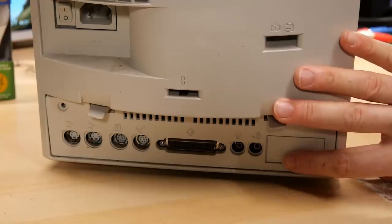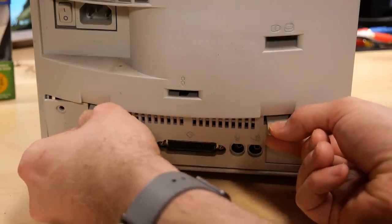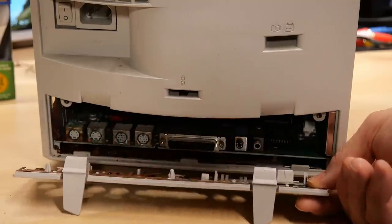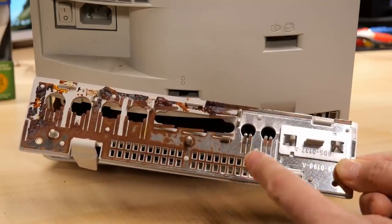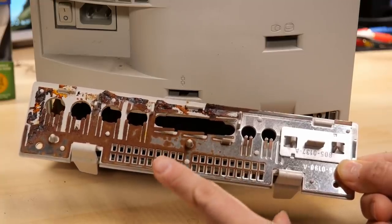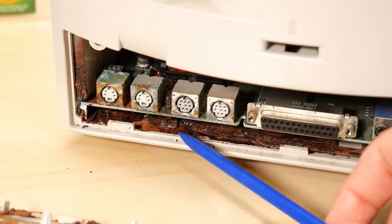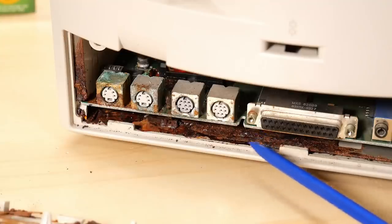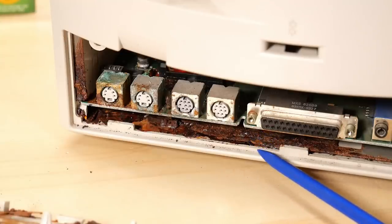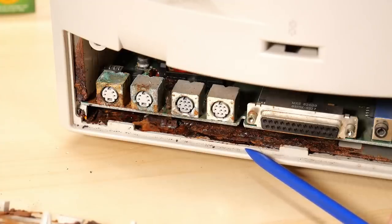In the intro, I had mentioned that this Color Classic might need some repair. It might be more serious than that. And the reason why I said that is because when you pop this little cover off, inside it's not looking so great. All of this rust here on the RF shield indicates one thing to me: leaking battery. I raised the camera exposure so we can get a better look at what is happening inside of this computer. This does not look good. If you watch my Macintosh repair-a-thon, I had a Mac Classic where the battery exploded on it — lithium battery, not a NiCAD like on a lot of PCs, just a regular lithium one. But they can leak, and when they do, it wrecks things a lot.